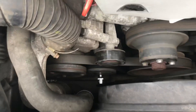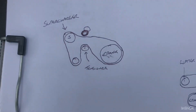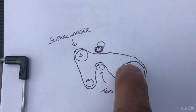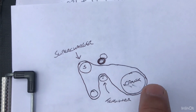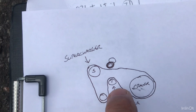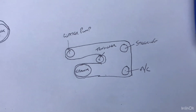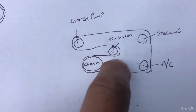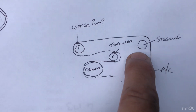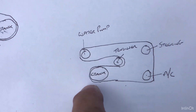First of all, you need to make a note of how the drive belts run. I took pictures but it wasn't clear, so I did a drawing. The supercharger belt: there's where the socket goes on the adjuster, an idler wheel, the supercharger, and the big crank. When you undo this, it comes down enabling the belt to be pulled off. The main drive belt: there's the big crank drive, the tensioner adjuster, water pump, power steering, and air conditioning. When you undo that, it pulls away and releases the slack so you can take it off.